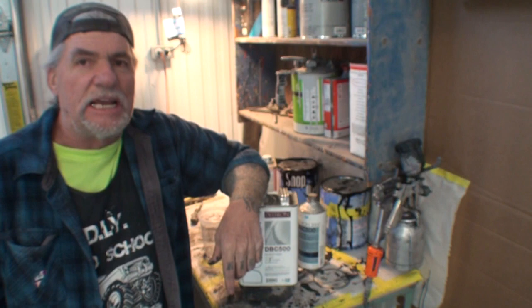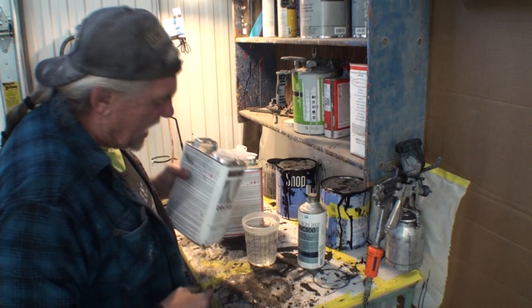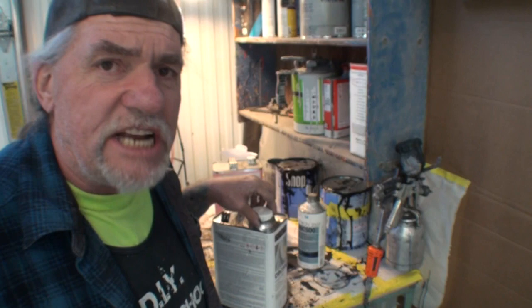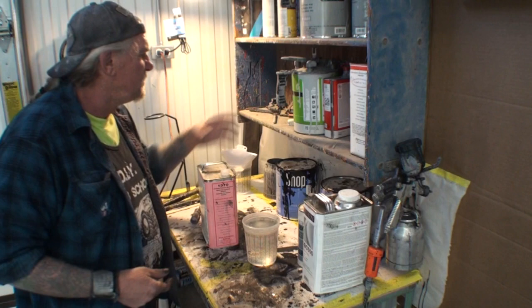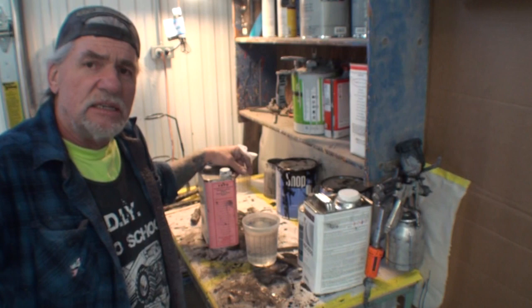So we're going to take our clear, and then I'm going to go ahead and pour it in here. And we're going to go 50-50 on that. And when I say 50-50, to make it clear to everybody that wants to be politically correct, 1-to-1 ratio. That means I'm going to use half clear and half reducer. So we're going to go ahead and do this. And that's it. We're going to go ahead and mix that up. And I'm going to get it in my spray gun. And then I'm going to show you how to spray it and how fast and efficient this stuff sprays on.